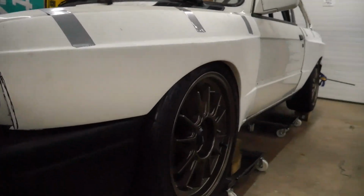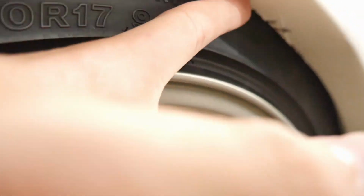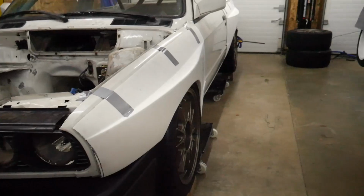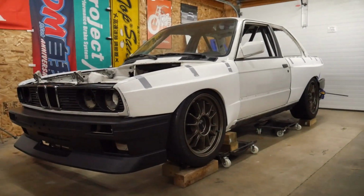But with this car, I want them to tuck too. Most of the guys building newer cars want them to be flush. With this car, I wanted a big wheel, but tucked in a little bit. So I'll show you with the front especially, it's gonna look different. It'll kind of look Battleship, like sunk in a little bit, because I run so much camber with this car, but as you can see with the front, if you look from the side, there's a whole lot of room. But in all reality, this is just leaned up there, but I know where it's gonna sit because of the factory fender underneath where it sat before. So you could see it's touching almost the inside of the fender. So it's actually really aggressive, but I wanna be low. So as you can tell, it's gonna sit in a little bit, but if you look at the look of the car, I think it's really gonna look good.